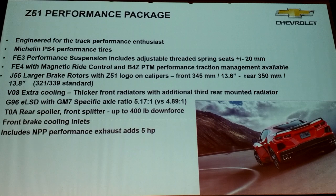Right out where the tires drive loads into the body, we put accelerometers on the knuckle. That lets us read what's happening at the wheel much quicker. We take advantage of that with our new electrical architecture, which transmits messaging four times as fast. We can really perceive what's happening out at the tire, and with software to take advantage of this, it's the best riding suspension we've ever had.